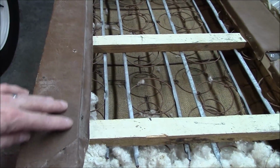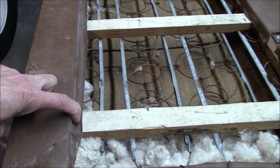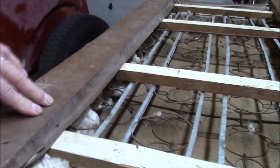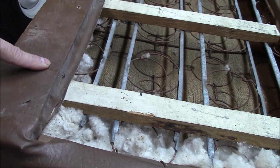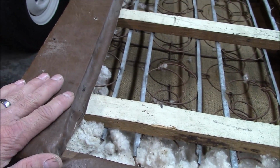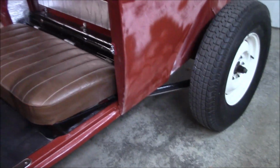Looking at the back of the seat, the way it's constructed, this board on the bottom is about 3/4 to 1 inch thick. And I'm thinking if I take this board off, see how it's on top of these? If I take this board off, use my biscuit joiner to make it flush with these, I can gain 3/4 to 1 inch of surface back on my seat, which moves me back some and down some.